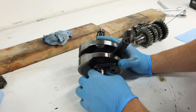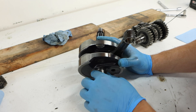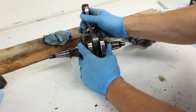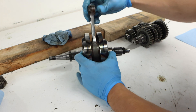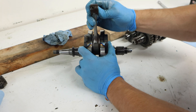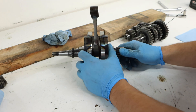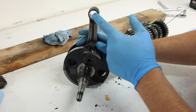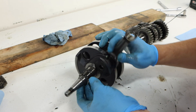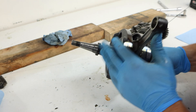The first thing to look at is the sealing surface where the seal and bearings sit on the crankshaft. If you have grooves you can feel with your fingertip, you're going to need to replace the crankshaft. Then check both your bearings — this bearing is seized up, but if it wasn't seized you'd check it for up and down play; side to side play is okay. You also want to check the top of the crankshaft where the wrist pin goes and make sure that's not worn or damaged. Finally, check where your cam chain rides on the crankshaft and make sure that's not worn out.